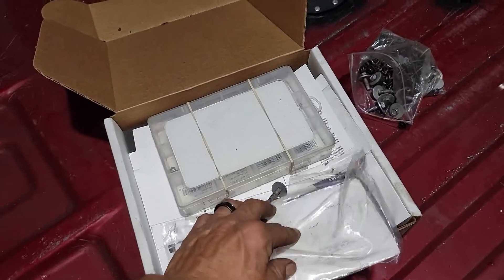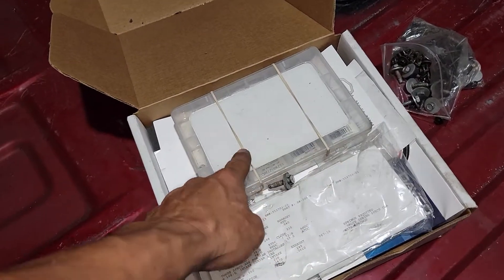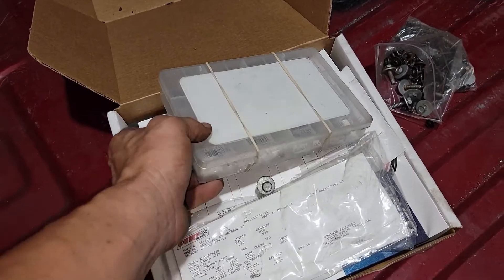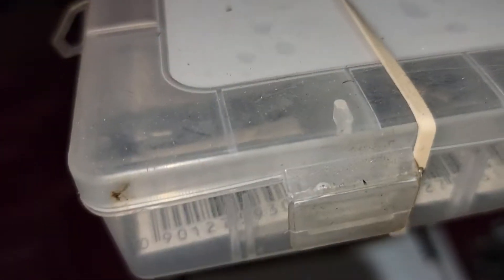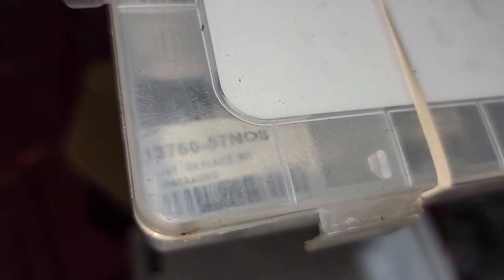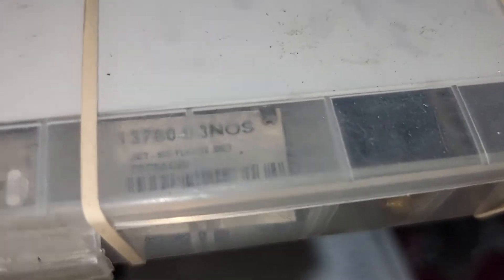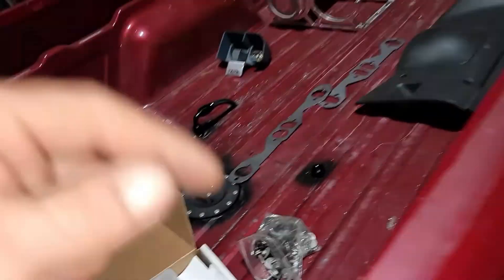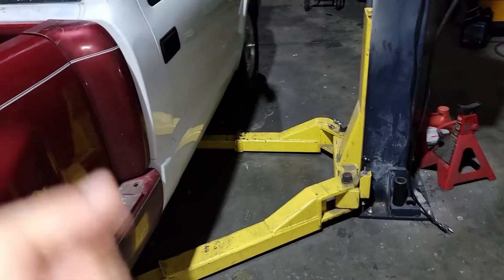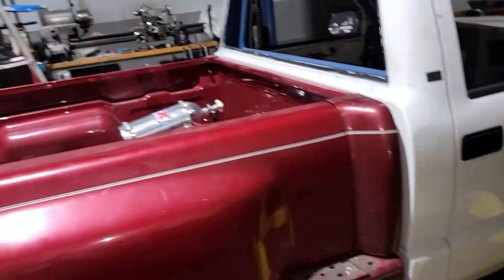I got his box with all his stuff. This is the cam card, this is the dashboard bolt, and these are all the extra nitrous fittings — I put them in a little case for him. You can see the barcodes are in there, and it gives him all the jet sizes: a 57, a 63, a 33, and so on all the way down to a 19. The 19 is in there on the fuel side because with fuel injection having higher pressure, you need a much smaller nitrous jet.